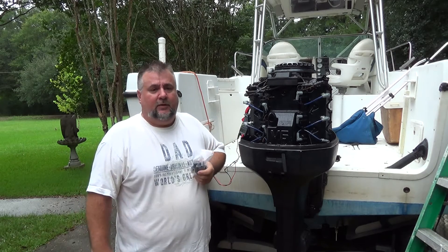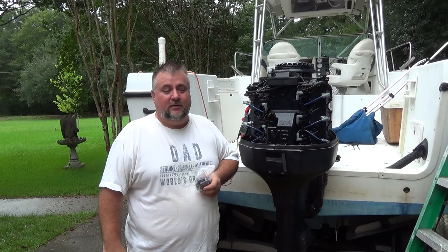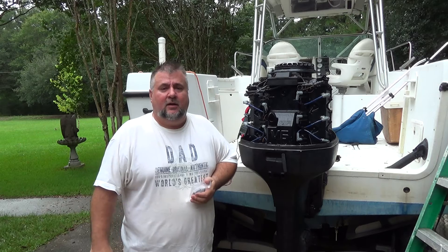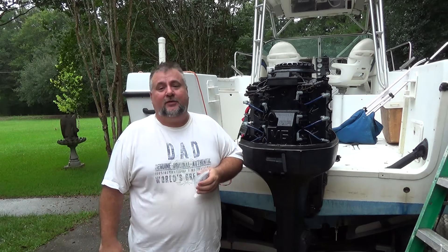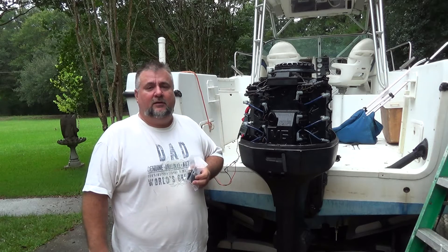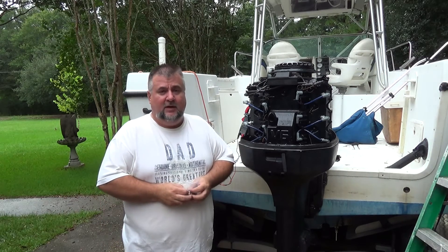Given the age of the motor and the relatively cheap price — I think these were under $20 a piece — I decided I'm going to go ahead and check the coils with a meter. We have all the parts we need, so we're going to go ahead and do this anyway and keep some of the ones we have as spares. We have some brand new ones and we're going to start this process by checking out the resistance between the contacts on each coil and then compare old versus new, to see if any are reading differently and potentially causing the hesitation.